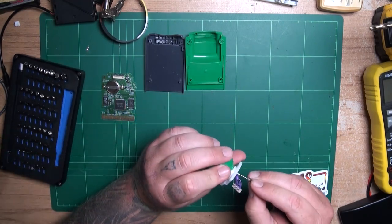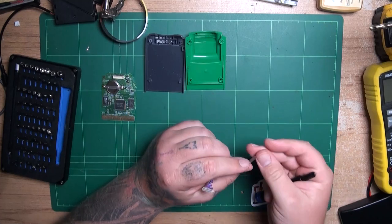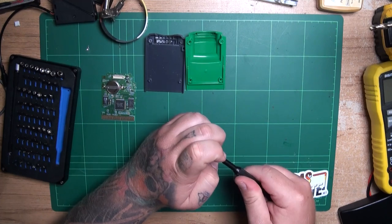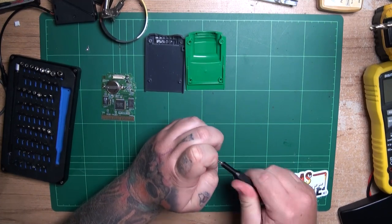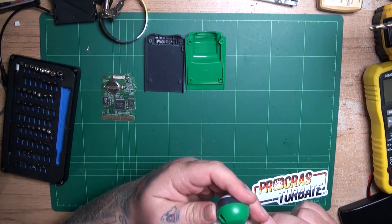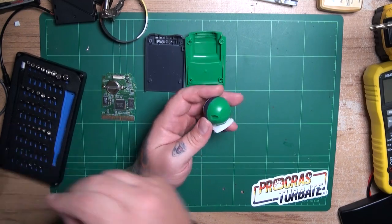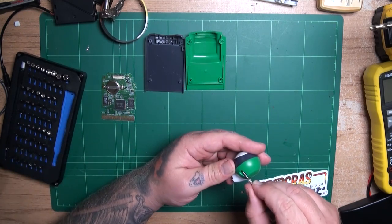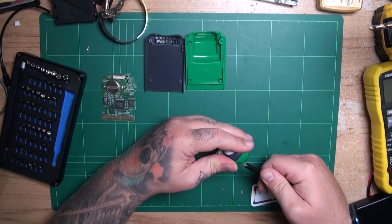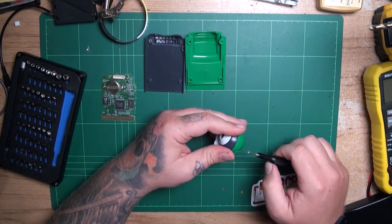Once you've disconnected that, there are two screws holding the little plastic pivot point together, so you want to unscrew them. This time they're just Phillips heads. They are in there quite tight so you'll need to use a little bit of force, but again be gentle as these are all old plastics. You can then use your game bit driver again to remove two screws from the back of the camera module, which will split that open and allow you to remove the camera itself and its PCB, as well as disconnect the other side of the purple cable which you can then feed through the pivot mount.